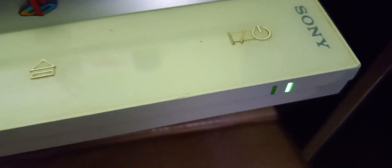Now I'm going to show you what's wrong with them — the issues are noted on the sticker or tape right here. The red light is on once we power it on. You can see it flashes yellow and then goes blinking red. It does the same thing for all of these PlayStation 3s, but this one takes a little bit of time to go yellow then red.